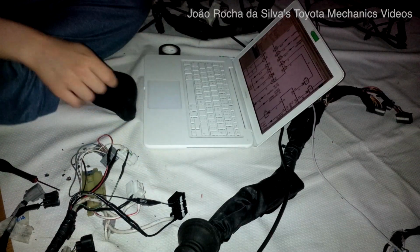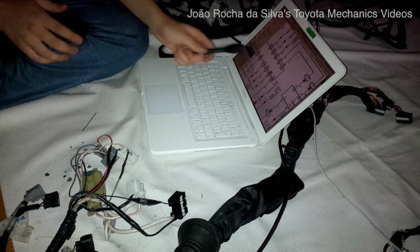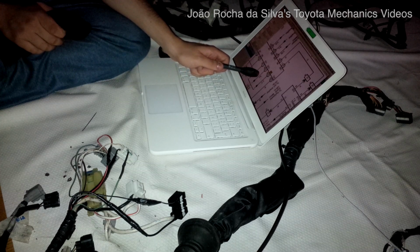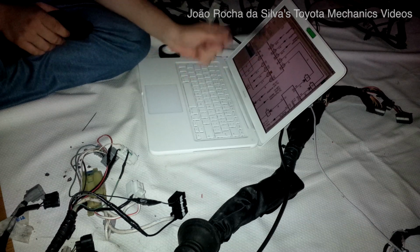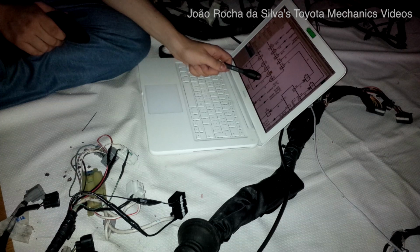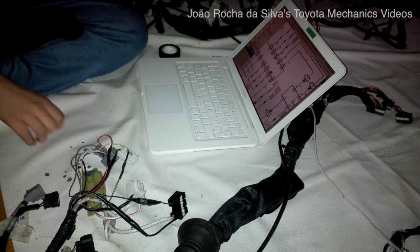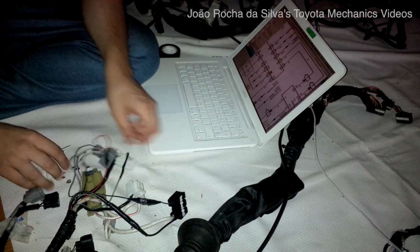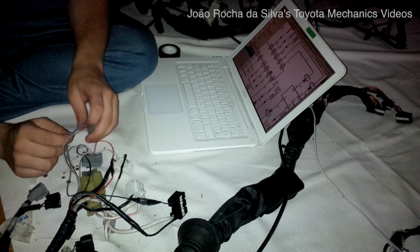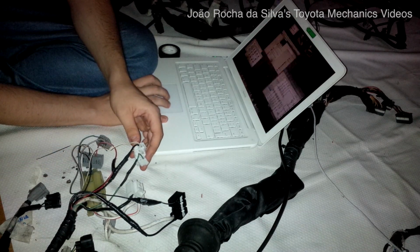So, after looking at the wiring diagram for the 4EFE, we can confirm that the IGF pin is indeed responsible for the ignition, for the pulse generation for the idling, according to the manual, and the color is indeed blue and yellow. So the role is the same on both cars, and the conclusion is that we have to remove this wire, blue and yellow, which is the B4 wire, and put it in the place where there was a wire of the same color.